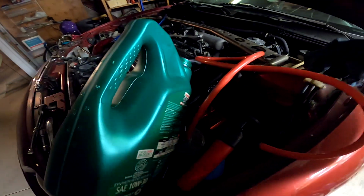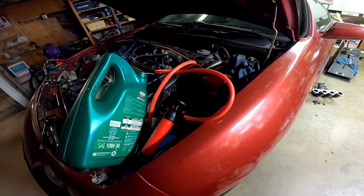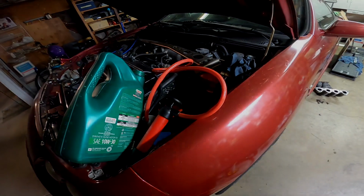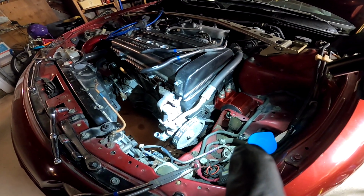I'm kind of scared to convert it to manual rack in a real sense, because I know when the car is off, you want to turn those wheels, we gotta really muscle on it. Pretty much that's it. After that I just have to drain some fluid out of the rack, and then get a fitting and do pretty much a rerouting on it. So the conversion in the real sense will be done.